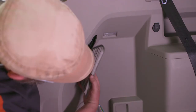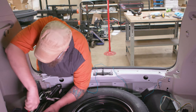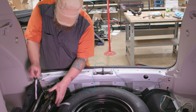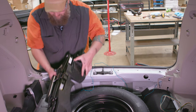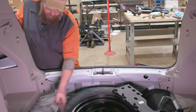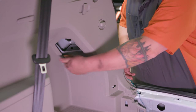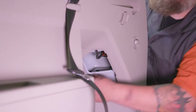Replace the louvered interior panel. Next, route the connectors with the green wire from behind the interior panel on the driver's side, along the rear scuff panel area, to the passenger side interior panel. Remove another interior panel to gain access to the passenger's tail light wiring harness. Disconnect the vehicle's tail light wiring harness connectors and insert the custom wiring harness connectors with the green wire between the disconnected vehicle's connectors, making sure all locking tabs are in place.